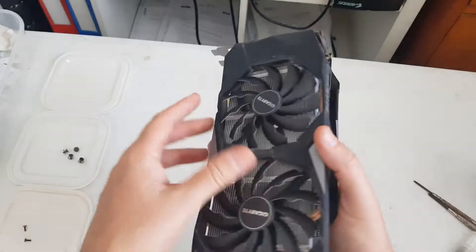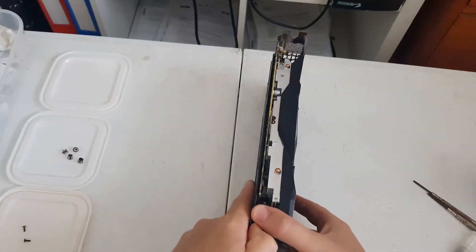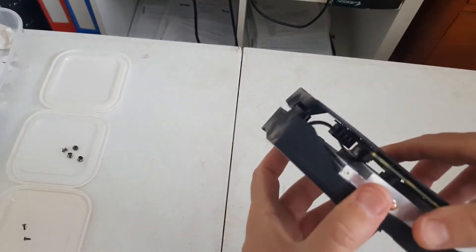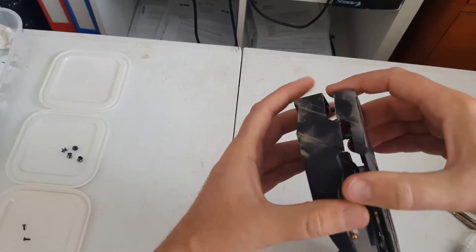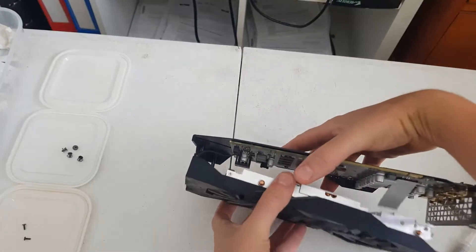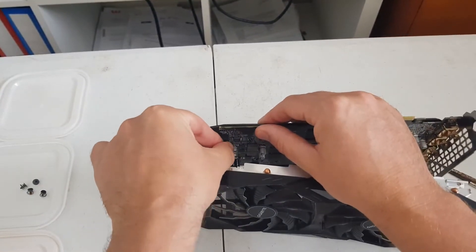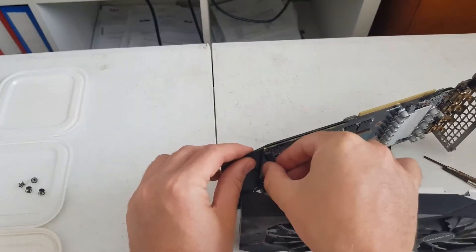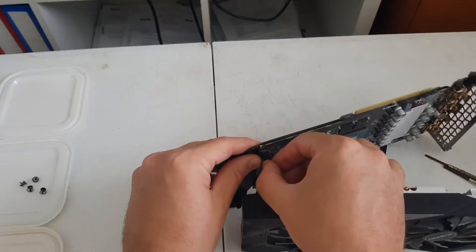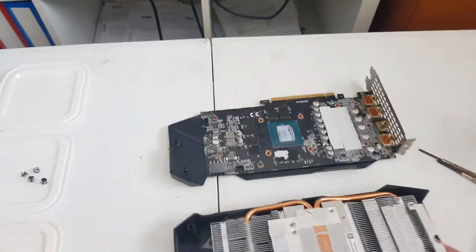Now we want to go up this end and get these two plastic grommets apart — you can see them a bit clearer now. So we're now separated. You can see the thermal pads hanging there. If I zoom in a little bit, you can see we've got the connector for the fan. We'll just wiggle that one out — it really is just a gentle wiggle. Hold it firmly and just very small wiggles, and there you go — brilliant.